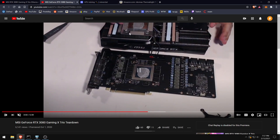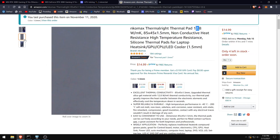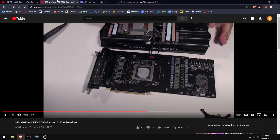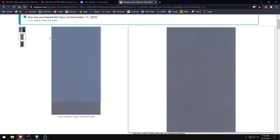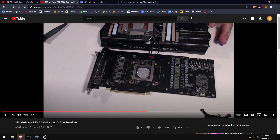The pads on the inside are 1mm. To replace them: get your new pads, press them down on the memory module and it'll make an imprint — you'll see four little notches — then just cut the pad perfectly to size and slap it right on there for a perfect fit.